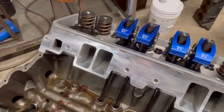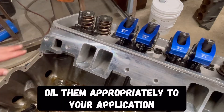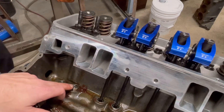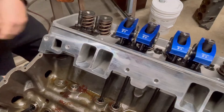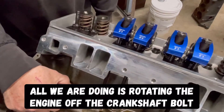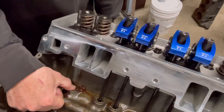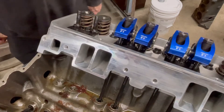The first step is to put your lifters in the lifter bores. You have to make sure your lifter hits on the base circle of the cam. With a small block Chevy, you can watch them moving up and down as you rotate the engine. You're going to rotate until the lifter stops moving and doesn't come back up. Right now we're on the base circle of the cam — that's all the way down.